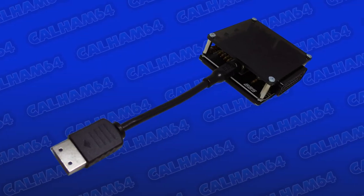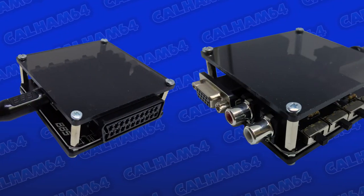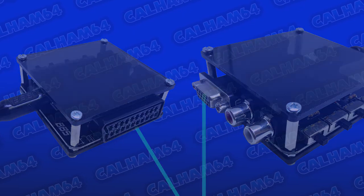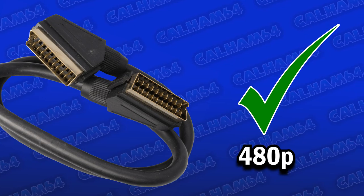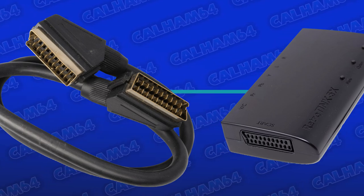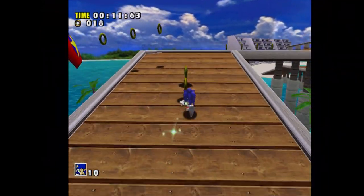Introducing the Toro by the Bahabros — a little device that has two high quality outputs: SCART and VGA. What makes this a step up is the ability to send 480p through not only the VGA port, but SCART as well. That's right, SCART can surprisingly do 480p if done right. It especially helps with professional video upscalers like the RetroTink 5X, as the SCART can feed directly into it and correctly upscale to HD resolutions. And we go from the footage looking like this — to this. Quite a big jump.